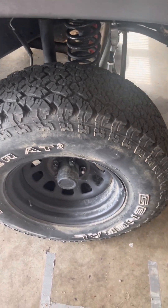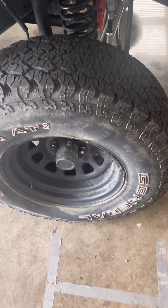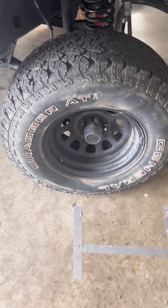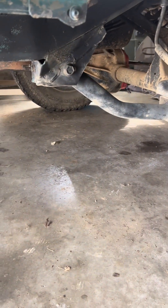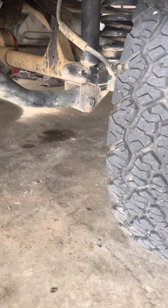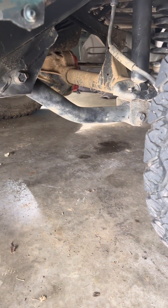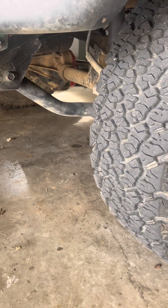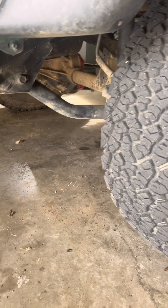It's probably easier for the video if I took the wheels and tires off, but since I've got enough clearance I'm not going to — just being lazy. This lower piece has a bolt and nut on the back side and down in the front. These are aftermarket lower control arms, but they're not adjustable, so I can't straighten out my wheelbase and put it back to center.